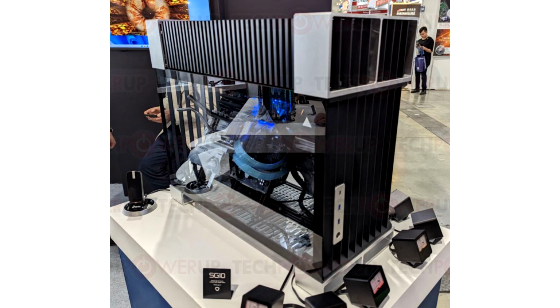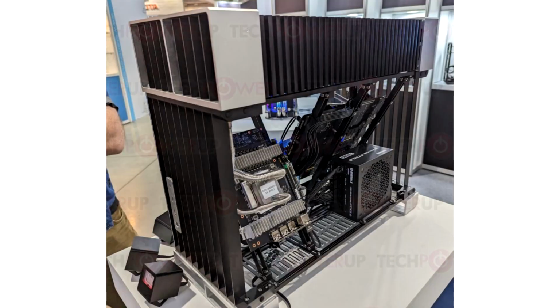The new design is a 15 kg metal and glass monster featuring two of CALYOS' specially designed loop heat pipe evaporation cooling systems that pull heat from the CPU and GPU, then passively radiate that heat away via two large condensers at the top of the chassis. The main body of the chassis is assembled from steel and extruded aluminum, and features tempered glass side panels. The front, rear, top, and bottom are all open to allow air to move through the chassis.